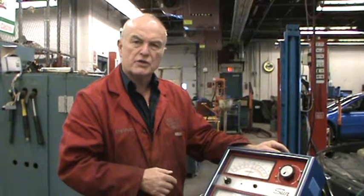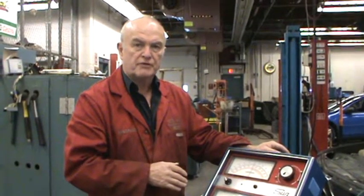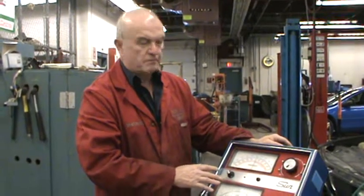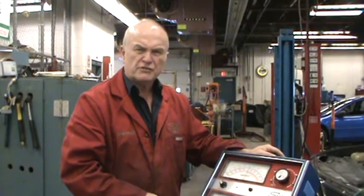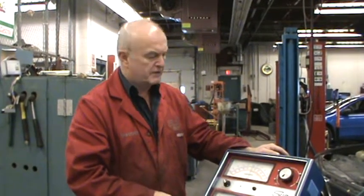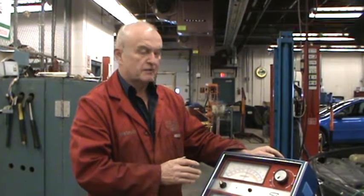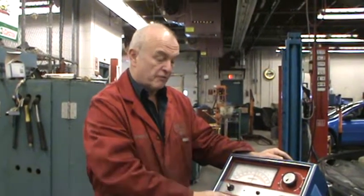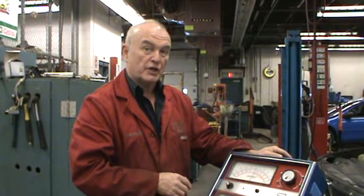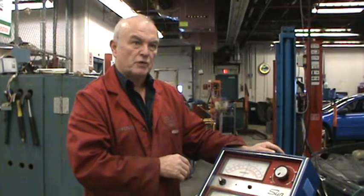One problem I noticed with this car is the voltage — regulated voltage is down a little bit, which may or may not affect the performance of the vehicle. We would conclude that the alternator is charging at 75 amps, and with the age of this vehicle, that's about all you can expect. The belts did not squeal and everything seemed just fine. So we're going to conclude that this one's okay, except for the voltage problem that we'll look into later — it's still charging when it gets under that voltage.